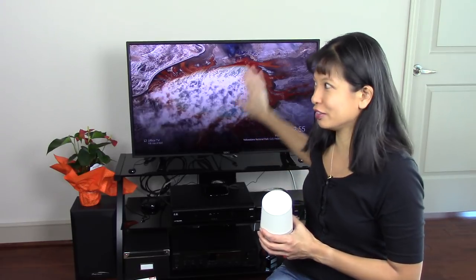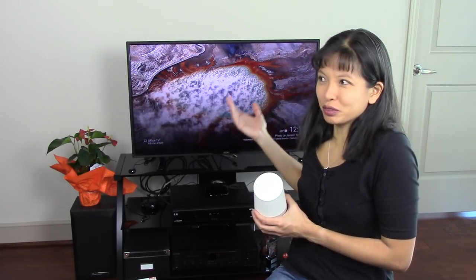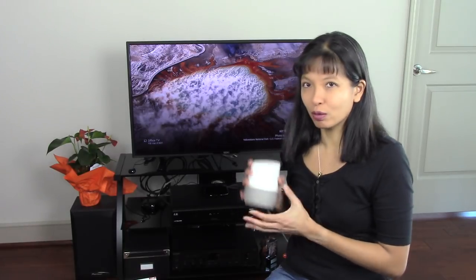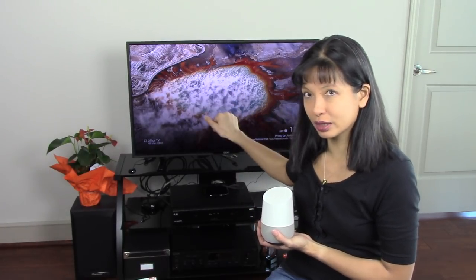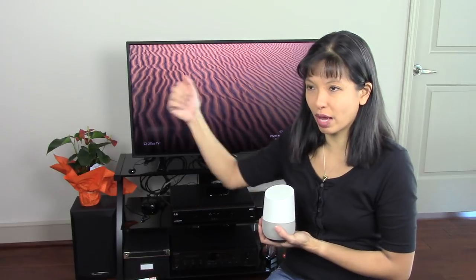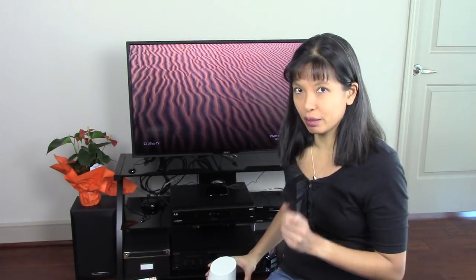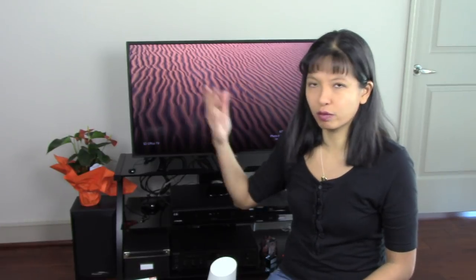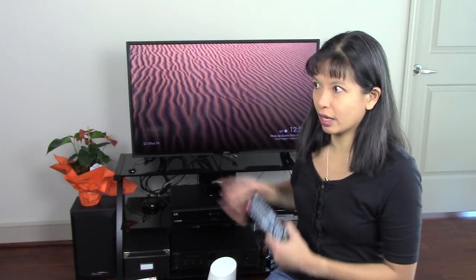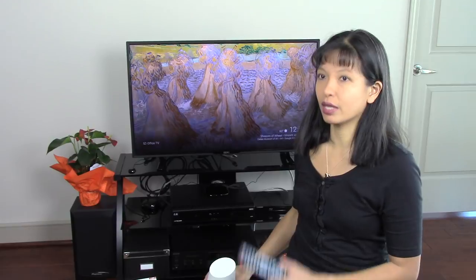This is just out-of-the-box functionality — these are not my pictures at all, and it's really kind of cool. There are a couple of caveats in all of this. It only turns on your TV if you have your Chromecast plugged into a power outlet or power strip behind your TV — not if you have it plugged into the USB port on your TV. The other thing is it doesn't change the input; it just turns on your TV to whatever input it was on to begin with. So if you have three or four HDMI inputs, it's going to go to the last one, which might be your satellite receiver. It only worked because I had it set up for the HDMI input of my Chromecast before I started this video. And the last thing is the Chromecast can turn on your TV, but it can't turn off your TV.